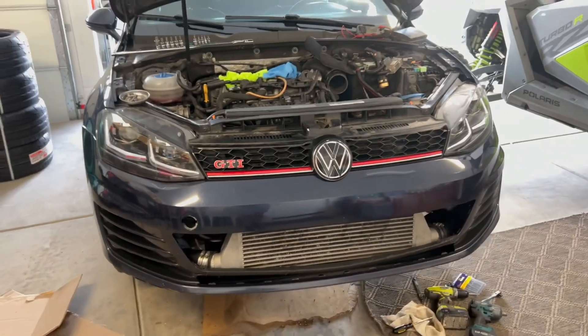I'm going to remove the oil pan and see what I found — and I found something, guys. I haven't taken the timing chain covers off yet because there's no need to do that yet. I drained the oil first, and if that was going to be okay, the next step would have been a leak down test to make sure the valves are seated and not bent. Those were the two preventative measures before touching the timing chain covers. And when I drained the oil and removed the oil pan, I 100% found something.